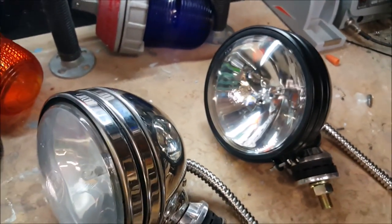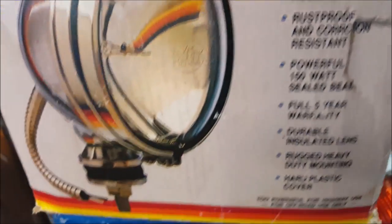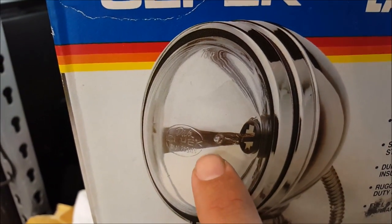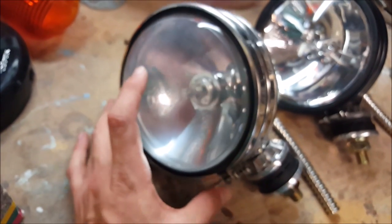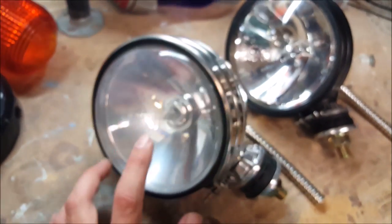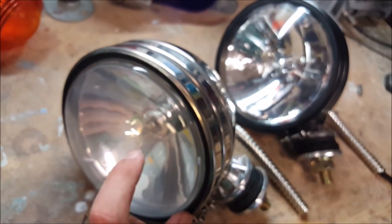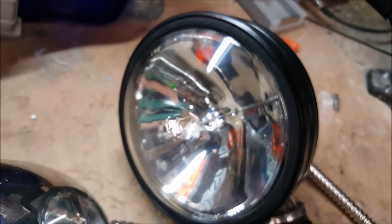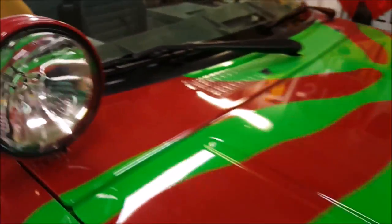They have a 150-watt sealed beam version, pictured here, and a 100-watt halogen version which has a removable bulb. What I found is the one with the removable bulb hazed over really easily — I don't know if it's because air can leak in where the bulb is mounted. It turned really hazy even though the truck had been in the garage mostly. Where you can see the sealed beam version is still perfect because no air or anything can get in there — you can really tell the difference. So I swapped it out on mine.